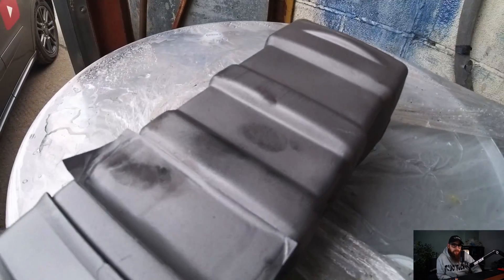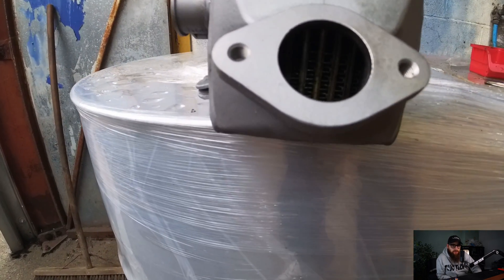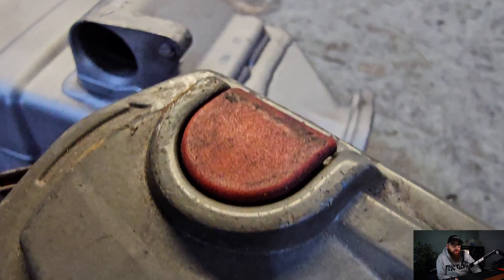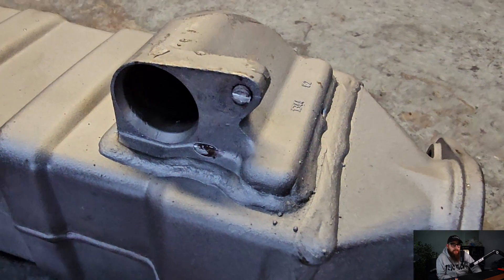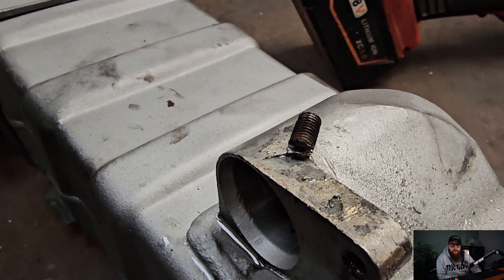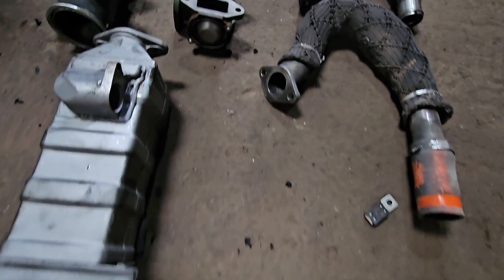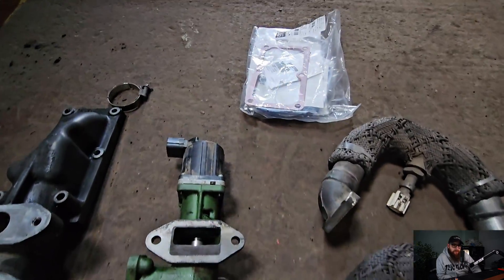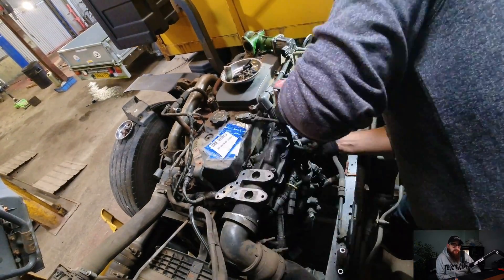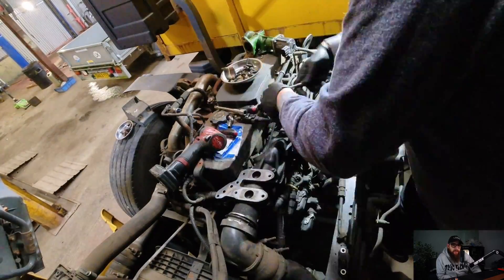With the coolant pipe finally free from the cooler, we can slip this EGR cooler out from the brackets. With our cooler sent out for cleaning, it's come back looking brand new. A quick cut with my angle grinder meant I could get a screwdriver in the snapped bolt and a touch of heat helped it out. With all my cleaned parts and new gaskets ready for assembly, with the EGR Venturi on, I could get the EGR valve and pipework fitted, and the cooler and gasket sorted also.